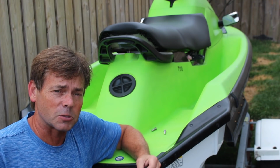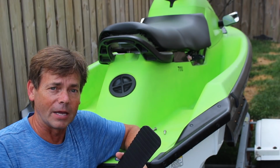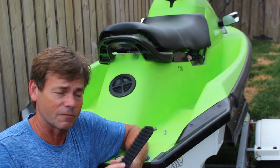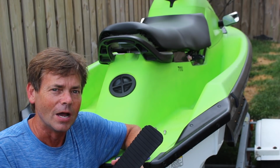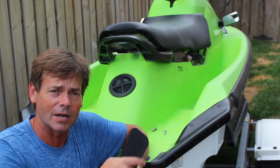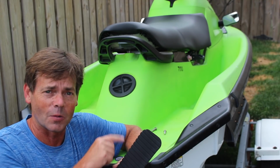It seems to me that it's really not advisable to stick these mats to a removable paint. My new plan is to cut around each of these shapes so that we can stick the mat right down to the fiberglass. Does that seem risky to you? It seems risky to me too. I'm going to try out this technique on a piece of plastic and see if we can actually trace around here, cut the line, and peel the paint back without damaging the surrounding area.